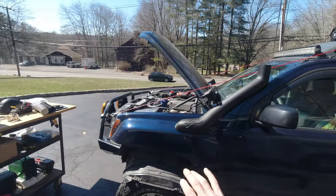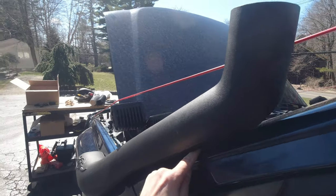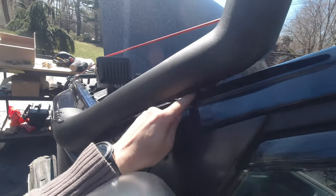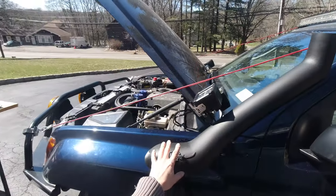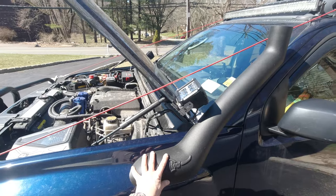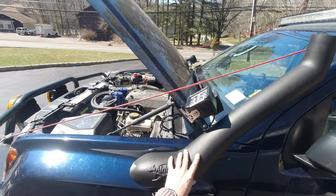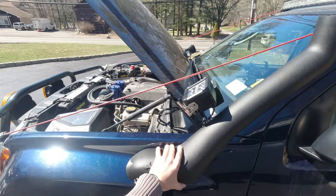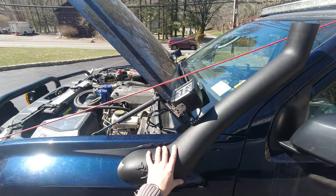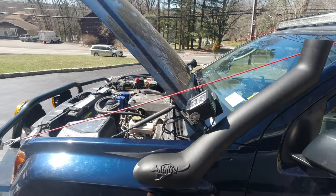It's a different day. Hopefully today I can finish up installing my snorkel. For the most part it's pretty much mounted. I think the well nut came out pretty good - it crimps and sandwiches in there, so hopefully no water is gonna get in. I did not install the top bolt or top stud - I cannot get to it, it's pretty hard. But the other bolts are secured and I feel like that's overkill anyway. It's not going anywhere; you'd have to rip it out.